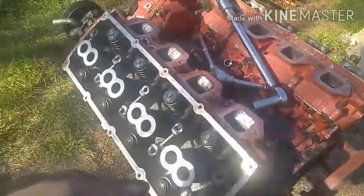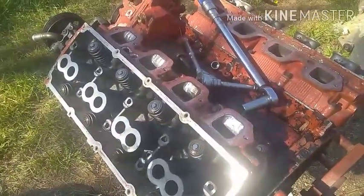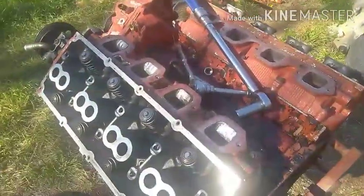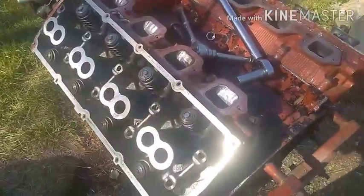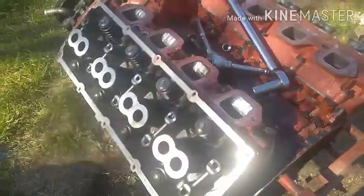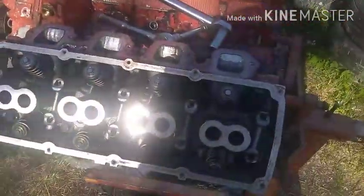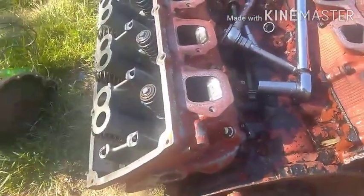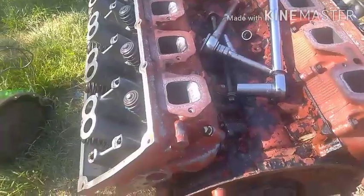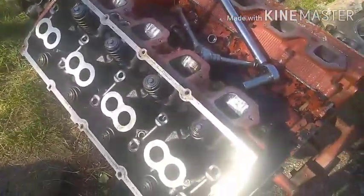And when I got to 40, I went through them all, put them to 40, and then waited a few seconds, and then went all the way back through again at 40. Actually did that 3 times to make sure they were all at 40, seated properly since there were new bolts, stretching, seating, and all that wonderful crap. And then I went through and did all the 90-degree turn, which probably puts it up somewhere near 80, 75, 80, 90 torque spec. I don't know why they just don't have you torque it to that instead of do the 90 thing.